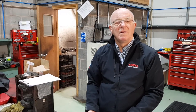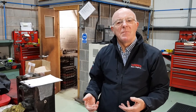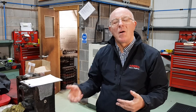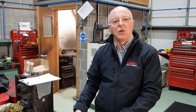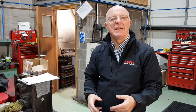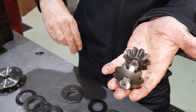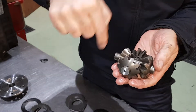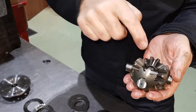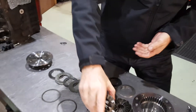What's the advantage of using one of these over a cross pin or an ATB? Well, an ATB is not really an LSD — it's what they call an automatic torque biasing differential, and it works through gear reduction as opposed to clutch plates. A cross pin is basically a glorified standard differential; in a standard diff with no clutch plates, the cross pin has two pins and four gears. If you're allowed to use one of these in your race car, this is the way to go.